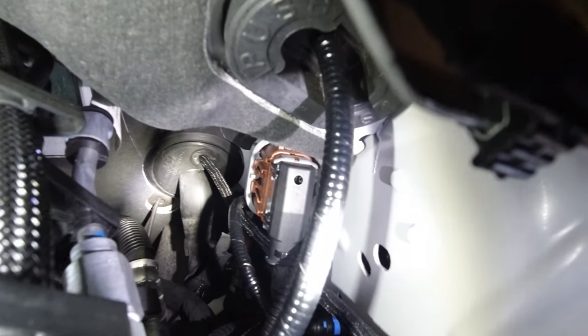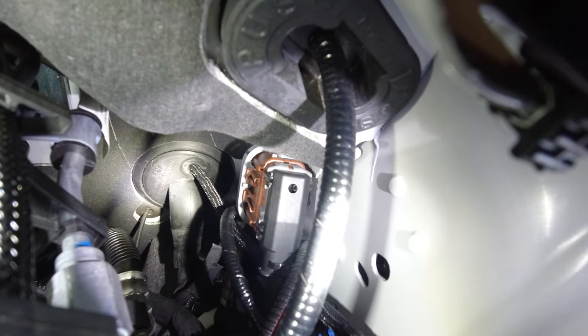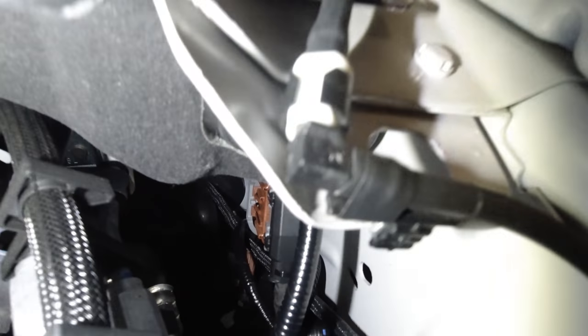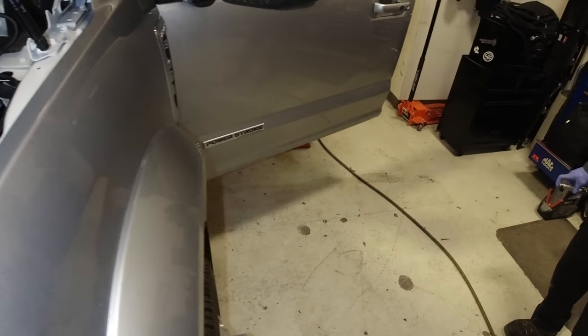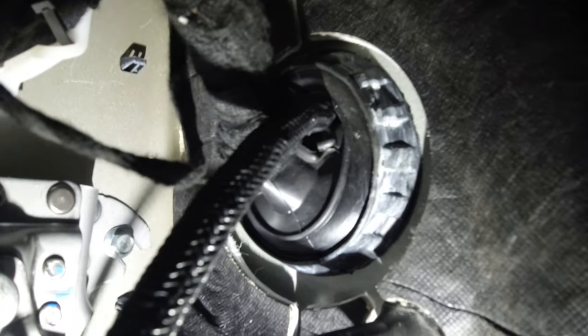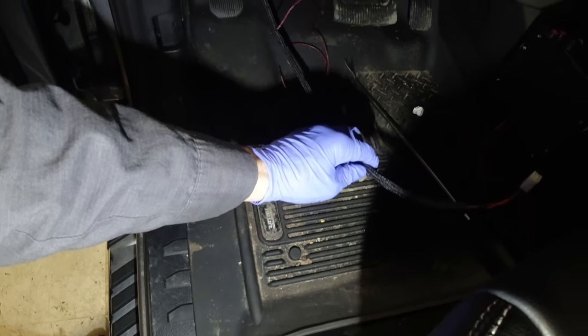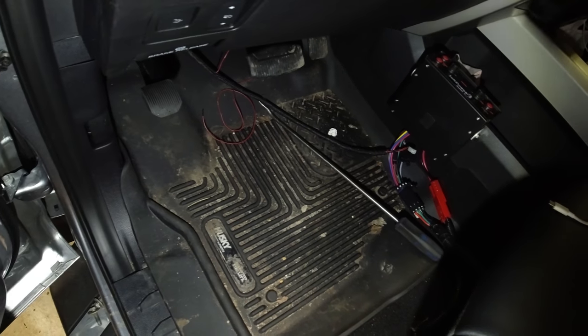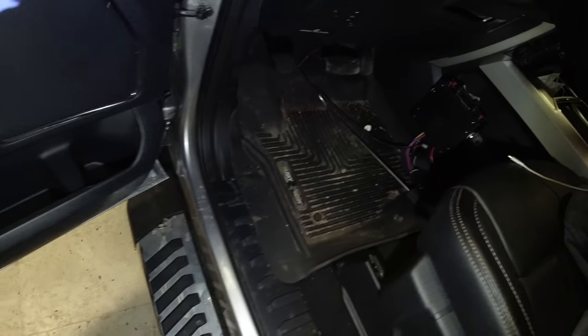You can see the wire coming through. I cut that rubber nub off completely flush and shoved it through the hole into the cab, and then you guys can see right where I came out, right by the harness, right through that rubber grommet and into the cab of the vehicle. And you want to take note to make sure you leave yourself enough slack so that you can hook up your plow stick. So we're going to continue forward and we'll see you in the next scene.